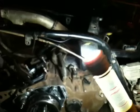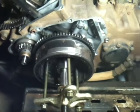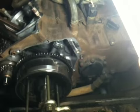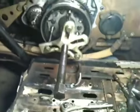I'm gonna get the engine out and split the cases. The first thing I'm working on is getting this little side cover off that the pull-start housing goes over, and I'm gonna try to get the Magneto off. Yamaha makes a special puller for it, but I did some reading and found that people could use a harmonic balancer puller. I got this AutoCraft brand one at Advance Auto.